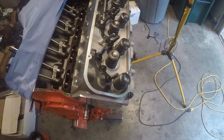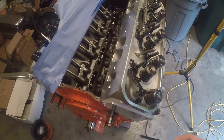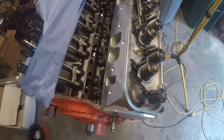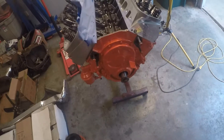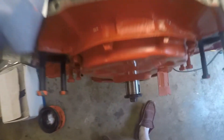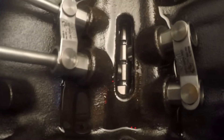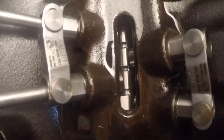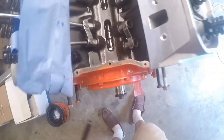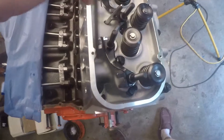Because if you get it wrong, it can cause some pretty big issues. So I'm going to walk you guys through the process and how to get it perfect. Right now I'm checking the exhaust valve of cylinder number one. I spun it over on the crankshaft snout to the base circle of the cam — if your intake's off you can see in there — get it on the base circle, not on any part of the lobe.